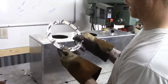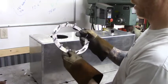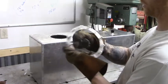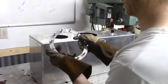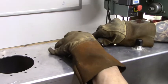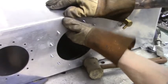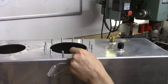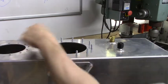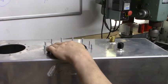Once you're done welding, this is what you should have. I went around and tacked each bolt twice to make sure they won't turn at all. Now all we're going to do is install this into the fuel cell. Make sure it's cooled down prior to installing the fuel pump and the Permatex seal. Now you can see we have all the bolts sticking up through — we don't have to worry about putting a wrench through the bottom where the fuel neck is to tighten them down.